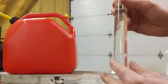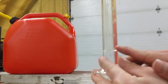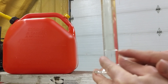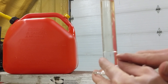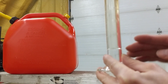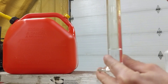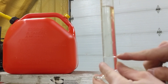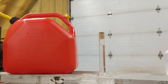If there was ethanol in there, we would perhaps see 13 or 14 milliliters of water mixture at the bottom. And if I actually saw that there was any, you could do this a bit more accurately and calculate the exact percentage. But in this case, no ethanol in that fuel — it's good to go.